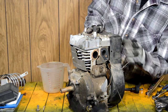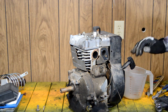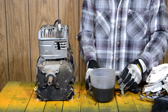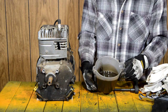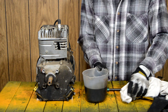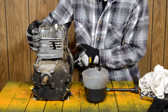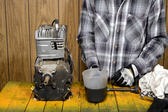I got that smelly fuel tank out of the house and brought it out to the garage. Next I'm going to drain the oil. This is the oil that came out after just five minutes of run time — it smells like gas. This engine has a diaphragm pump style carburetor so it doesn't drain into the cylinder, and there's no evidence of gas draining in on the intake. This engine just has a ton of blow-by, which is all the more reason to rebuild it.